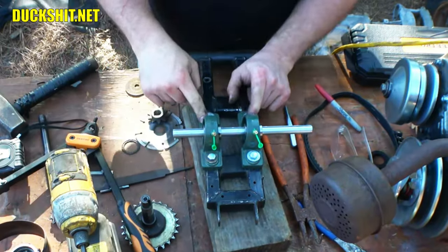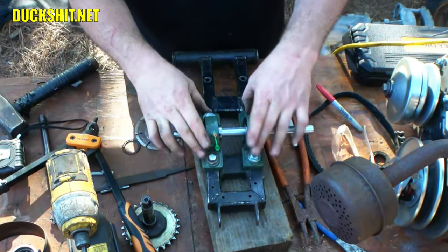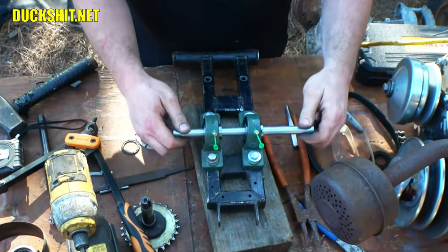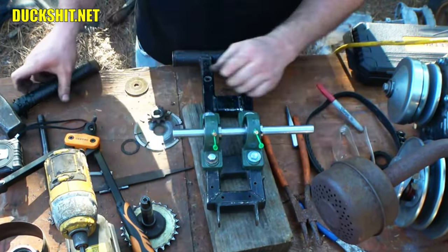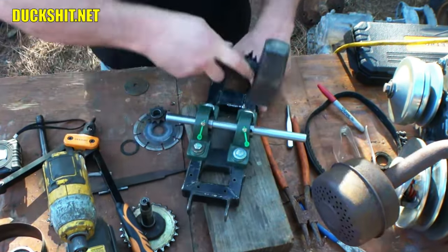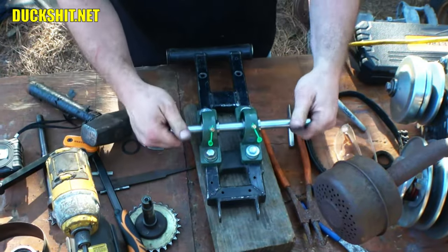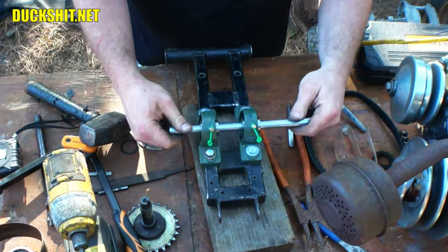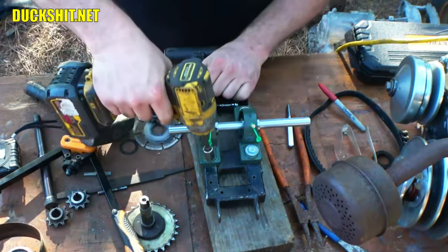Also, tightening these bolts is what does the final crimping on the riv nuts, so that's now in there, and this is turning properly. Feels a little stiff. Something is bound up a little bit. Probably just tap the shaft a little bit. Get the bearings to align. Yeah, it's a lot better. That was part of the issue here. Okay. Anyway, pop this one back.